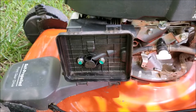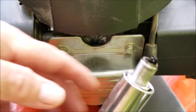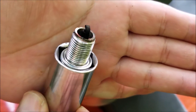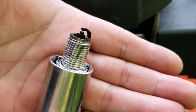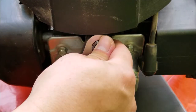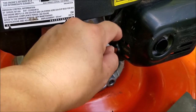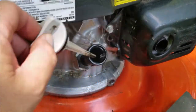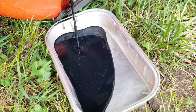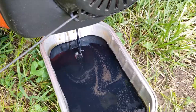The engine ran much better without the old filter and ran worse when it was replaced. I then used a brand new filter and there was absolutely zero effect, so the old filter was the reason why the spark plug fouled up with carbon. Just running it briefly with the old filter already has the spark plug very dark with carbon. Using a clean air filter will get rid of the rest of the carbon on the plug. After running the engine the oil should be pretty warm, so I'm going to tip the mower over and drain out the oil — it was definitely due for one. Oil changes for mowers are really inexpensive, so it's just cheap insurance to do them every season.